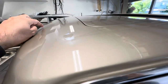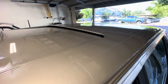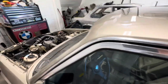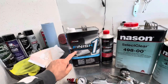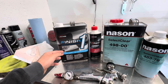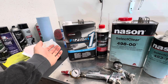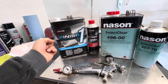I like the Nason because it hardens really quickly. My biggest gripe with the FC-720 is it takes forever to fully harden, and a lot of clear coats are that way. But the more expensive LC4100 that I've used will harden in a couple of days no problem. This stuff seems to take like a week or so.